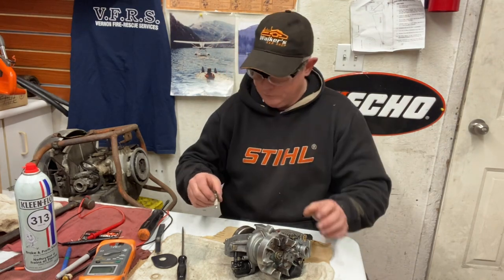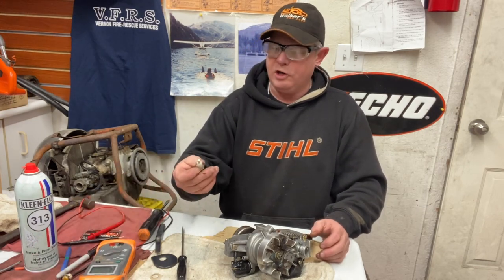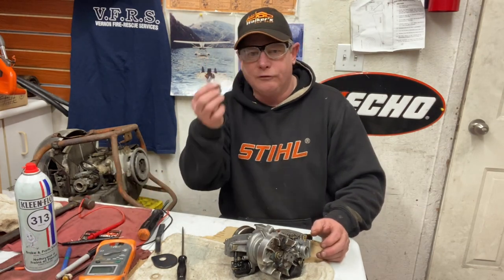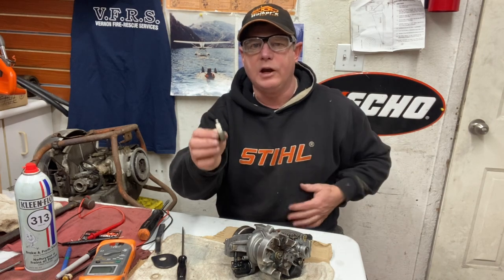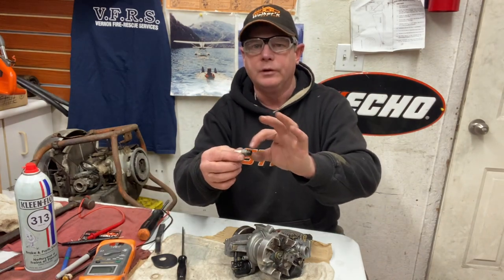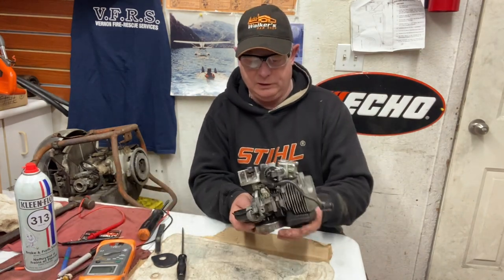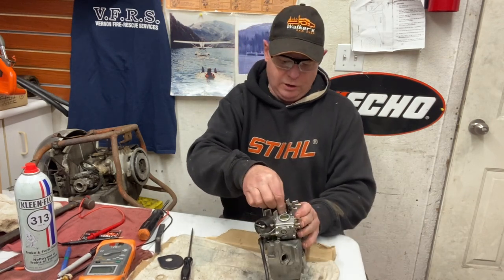Spark plugs — I used to use Bosch HSAEs, they're a small tapered type. This is a Champion EJ8J. You need ones without washers, with a little taper to it. So I've set these at 18 thou, it's got spark. Now I'm going to show you how to set it with the ohmmeter.